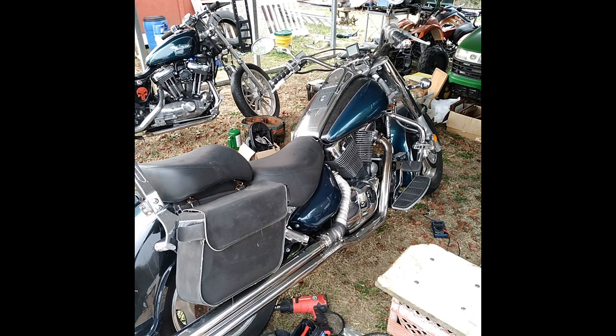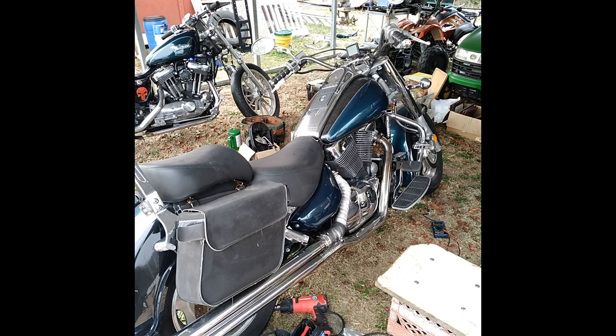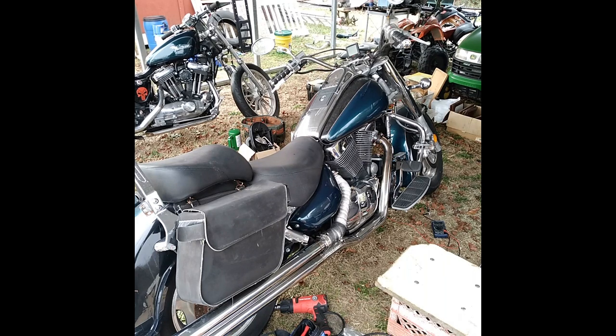Keep an eye on your battery connections because they do come loose. I always put a battery sealer on them. Good grounds are important — probably 99% of electrical problems on vehicles are because of bad grounds. If you've got lights that are flickering or dim, go around and tighten stuff up. If you have to, clean things off — dielectric grease helps out, especially on the regulator leads.